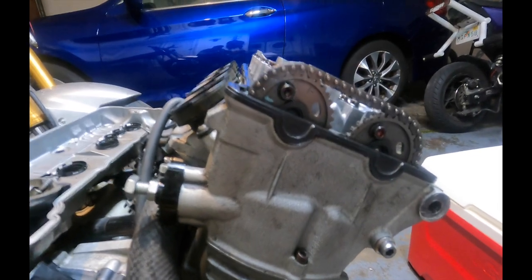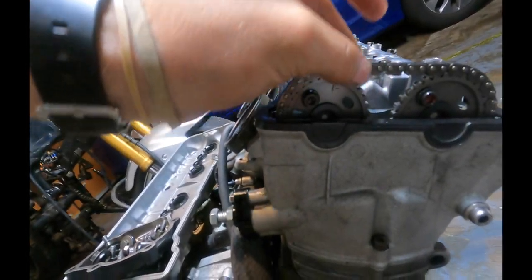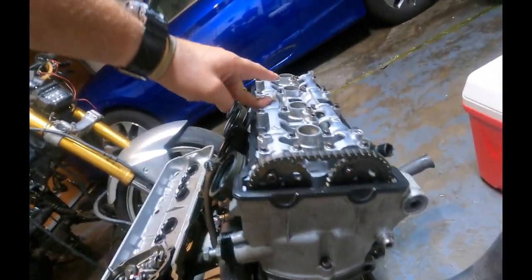You should be able to crank your bike right up and if the cam chain tensioner was the problem, your sound will go away — it's that simple. If you get on it whenever you start hearing the sound it's going to save you a lot of headaches. Don't let this problem persist, because if your cam chain skips a tooth on the sprocket it throws your timing out and it could lead to catastrophic failure — like your motor literally blowing itself up. If you hear that sound, do yourself a favor and take care of it.